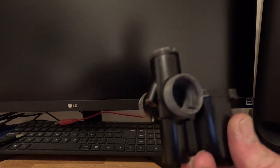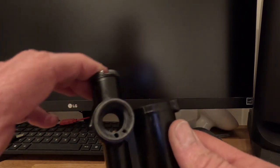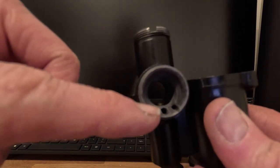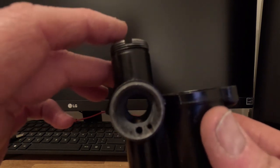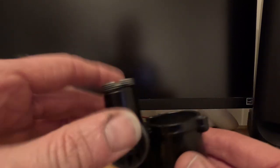Fairly simple to put together. The first step was to do some ultrasonic cleaning. What you find with carburettors when you rebuild them — there are quite a lot of small internal passageways within the casting which are almost impossible to get to by hand, and actually the ultrasonic cleaning is amazing. The outside of this carb had already been cleaned up, but when it went in the ultrasonic cleaner it ended up looking like this.